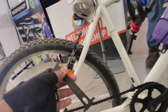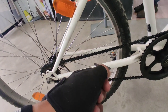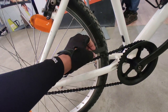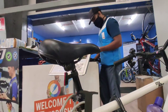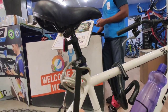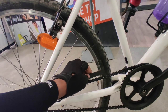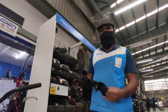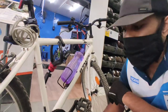I think it is around 399. So this is the tool. One side you have to mark here is 50, and the other side you have to mark here is 70. You have to keep it here. If it goes inside freely, this means 50% is worn out. So you have to change at 50%? It will also work at 75, but when it is 75, I am going to check here. If it is in 75, then we need to change. Actually, if it is more than 75, you have to change.